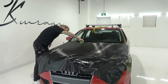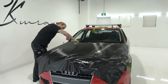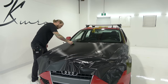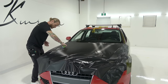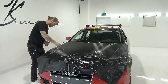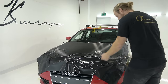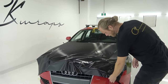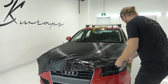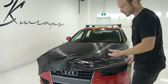You don't want to leave any air behind. You might notice that I'm not squeegeeing all the way down to all these huge wrinkles down here — we're going to deal with those in a minute. You can hear the texture. So far it squeegees really, really nicely. I'm going to stop there. I'm going to have to add heat at a certain point because this becomes a compound curve as we near the front of the hood. If I don't add heat, I'm concerned about it tearing. If we don't add heat, we usually won't be able to get all of these wrinkles out.